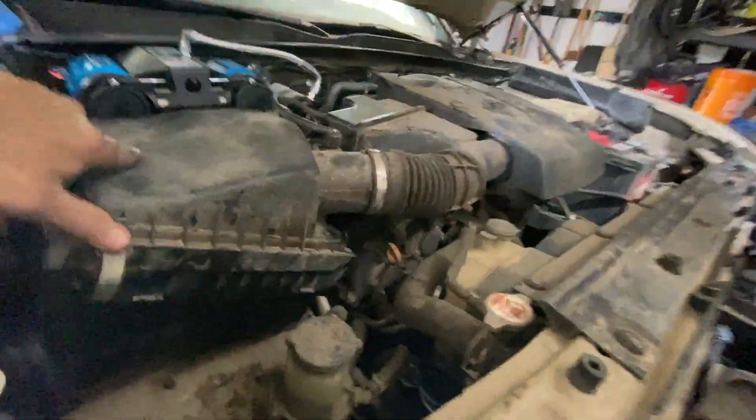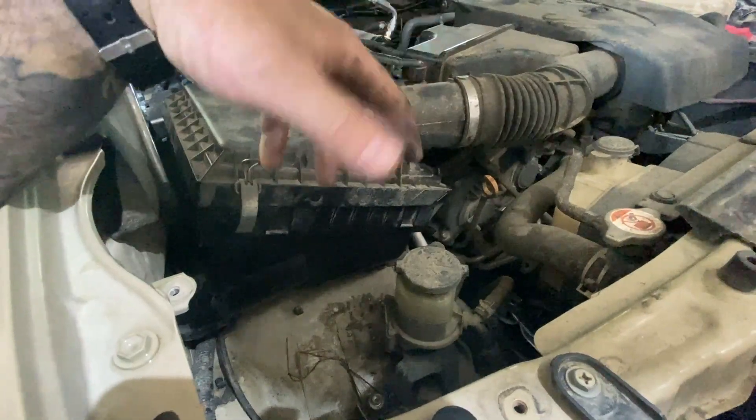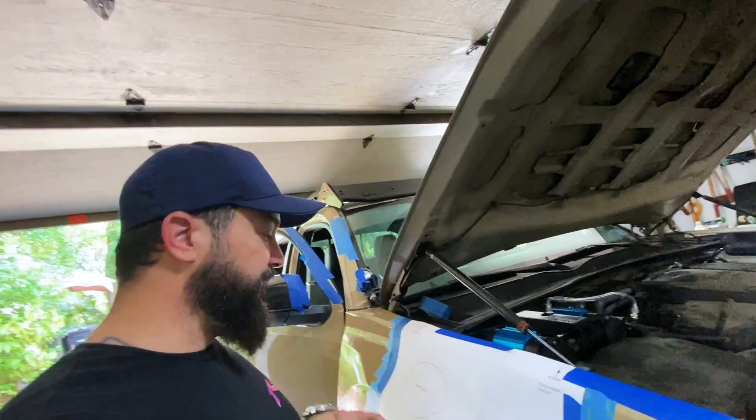Here's the air box back in. Since I'm tight on space, I removed the windshield washer tank just so I could maneuver everything, because it was not easy getting that silicone piece through the hole with its 90-degree bend. What I ended up doing is pinching the silicone and shoving it through the hole, then working it into position. That way I got a nice sealed connection on the inside. Just be prepared — it was not easy getting it through that hole.